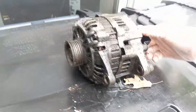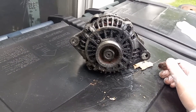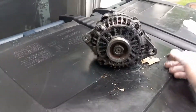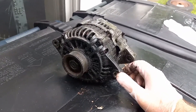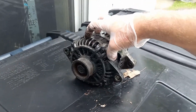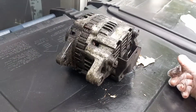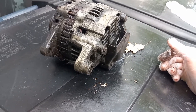I'll show you how to do that so you can save yourself $160, possibly — or at least extend a little more time out of it, because eventually it's going to need a new one. You clean where the brushes and the commutator are, and it generally works pretty good. There's a little trick to putting it back together, but once you see it, it's easy and you won't be afraid. This is an extremely easy thing to take apart and put back together. You just have to remember where the exterior nuts and bolts go, and that's it. I'm going to take that apart, clean it, and show you all the parts on the inside.